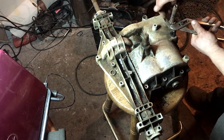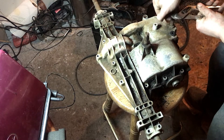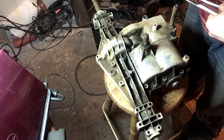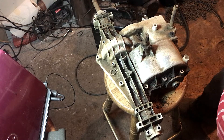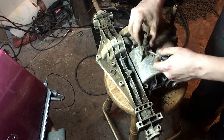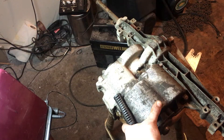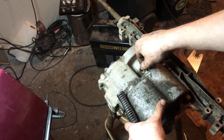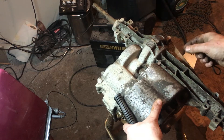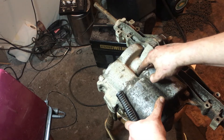Now I'm getting to this, whatever you want to call this — I guess it's here for a reason. They probably have a tool to remove this but I don't got that. We'll get the washer off and see what we're working with. I just wanted to point out that on this specific transaxle, you got to turn the thing over and there would be two bolts at the back. You have to make sure you get to those before you can crack this open.